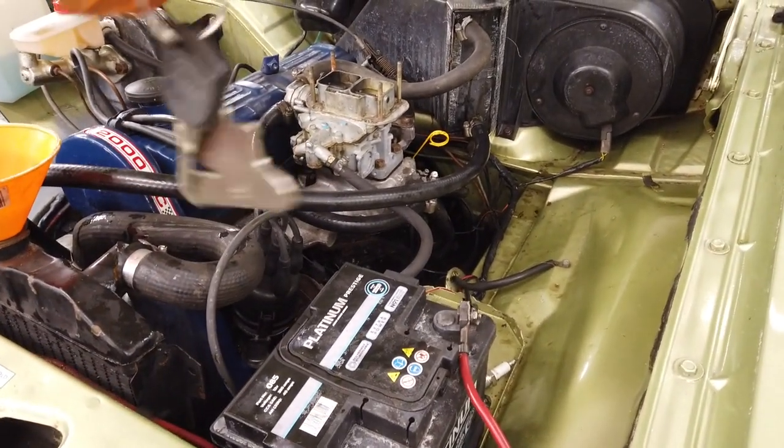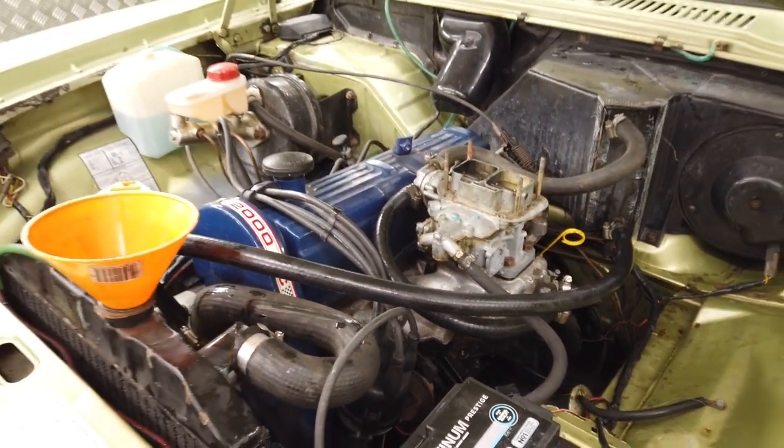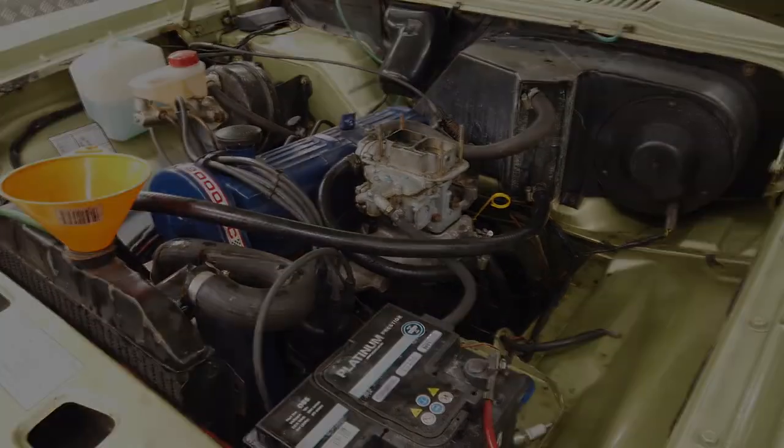Firing the engine up, see what we do, see what the colour tune's like, and then get the air bled out of the heater matrix, check for tools dropping down, my usual mistake. Points probably will need some attention, we'll have a look.